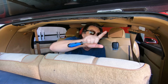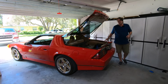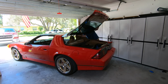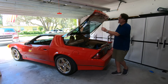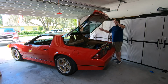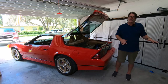Yep, I can see the bolts here, and oop, covered them up over there with the kill mat. And so you'll want to go ahead. What we did was loosen that up till a couple of threads. And then once we got into position, we basically got on each side. We loosened it from underneath. And then, of course, we also took off the strut supports, popped them off. There's supposed to be 2 bolts here, but I've never had them. And I just realized that, so I got to pick up a couple of these bolts to keep these on. So you'll want to take these off and then just lift the hatch off. So it's just 4 nuts then, 2 on each one of the brackets. Lift that hatch off and go ahead and set it down.